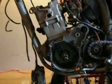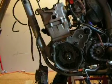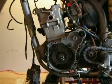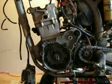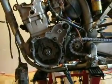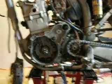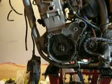Now I'll just reverse the process: put the camshaft back in, put the chain on the gear, put the nuts back in, and do a valve clearance while I'm in here. Nothing other than standard tools is needed except for the one Motion Pro or Husky gear puller. You could probably do it without taking the front fender off — I took it off because it made life a lot easier. I took pretty much the minimum apart; I didn't take the carburetor off, the air box off, or the sprocket cover off. If you delve into this and get stuck at all, feel free to email me at edward@topgeek.com or PM me on Adventure Rider. Thanks guys.